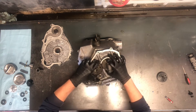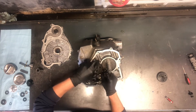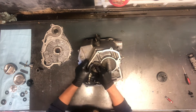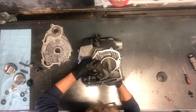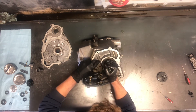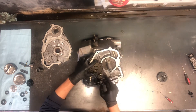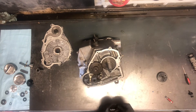Keep in mind the oil pump gear is also tapered and we've got to turn this slightly down. Sometimes you can hook that Woodruff key and kind of turn it. You can look right down and see if that Woodruff key is lined up. The hard part is it's really hard to get a hand in there to turn that crank balancer — you almost have to pull that gear off. Once lined up, make sure you can see that Woodruff key in there and that there's enough room with that crank balancer to allow it to move up and down like that.